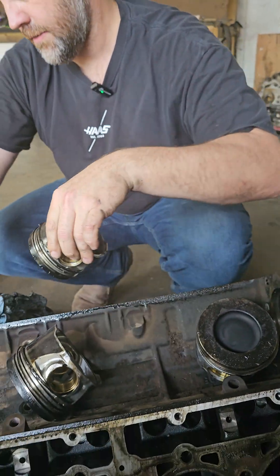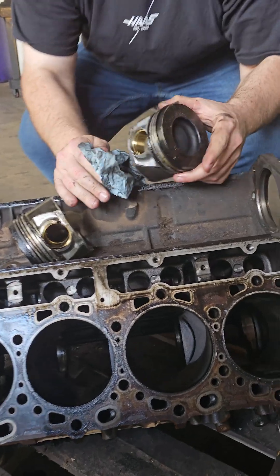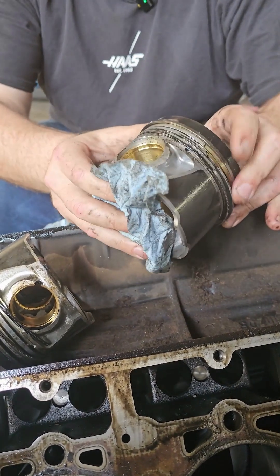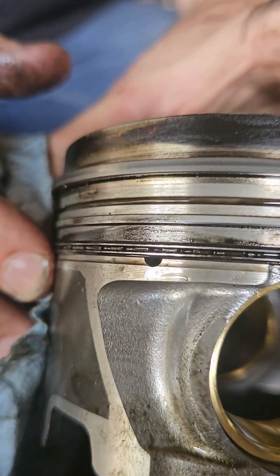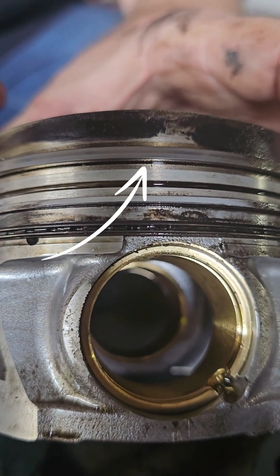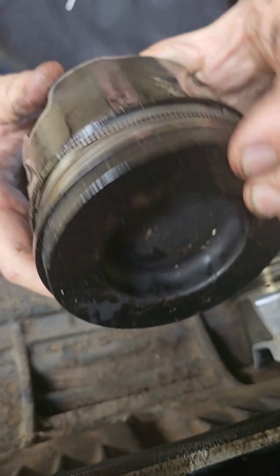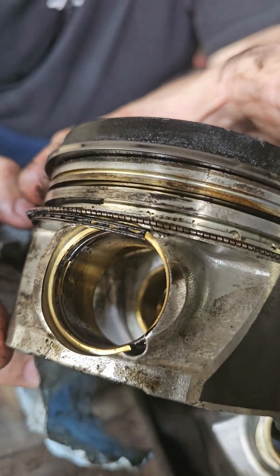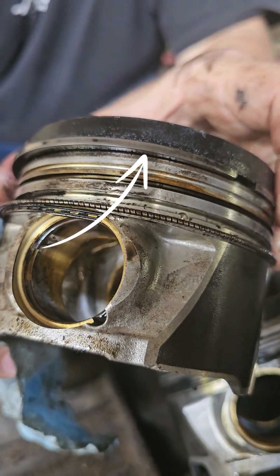Let me grab another piston. I've got a piston that's actually in pretty decent shape comparatively speaking, and if we look really close you're going to see a light mark. That mark is basically where that ring is lapped into the cylinder wall. This one's really really small — pretty hard to see. On another piston with scoring on the skirts, if we look at the same ring, you're going to see a much wider area. You can see that one of these things was living a very different life than the next.